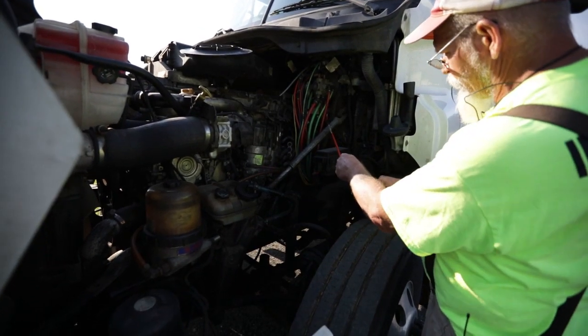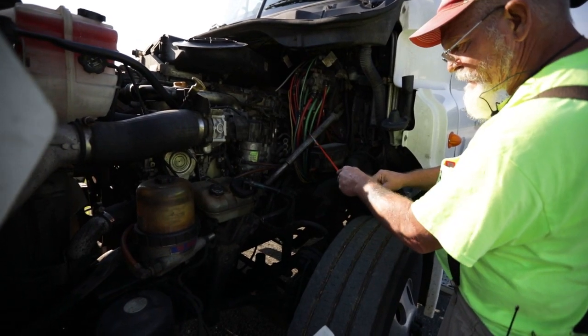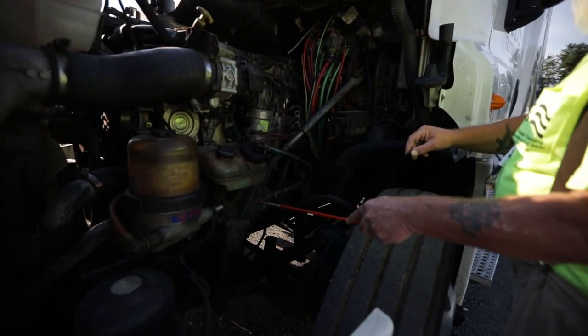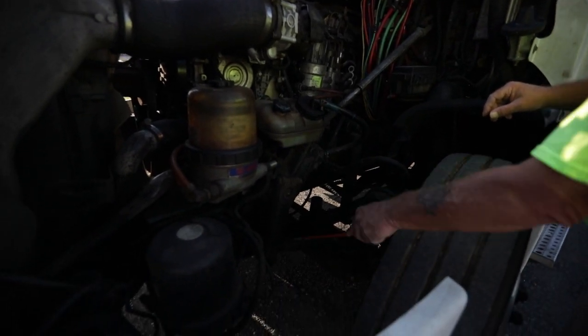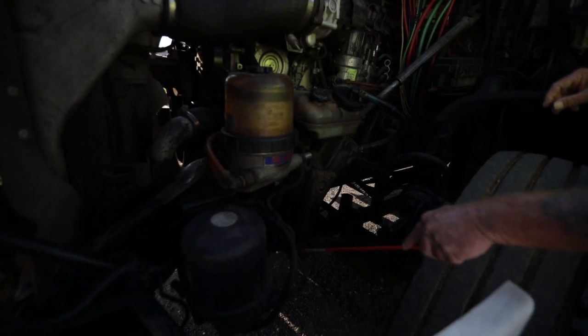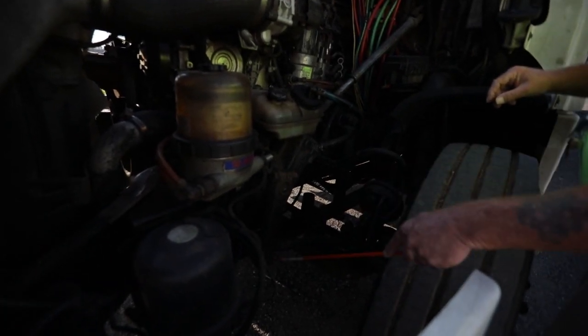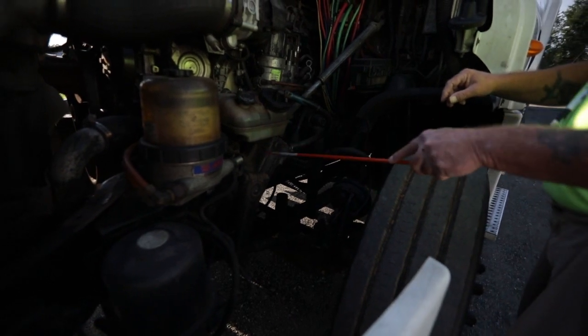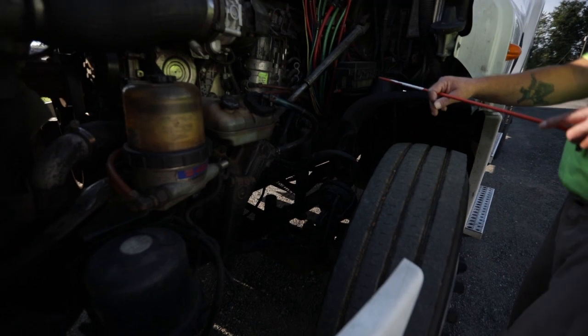Then I'm going to go to my steering components. I've got a steering rod, a steering box, a pitman arm, a drag link, and my steering knuckles at both ends of my drag link, along with my castle nut and cotter pins. They're not bent, cracked, or broken; no missing nuts or bolts; and I see no leaks at my steering box, because that's the only place fluid is going to.